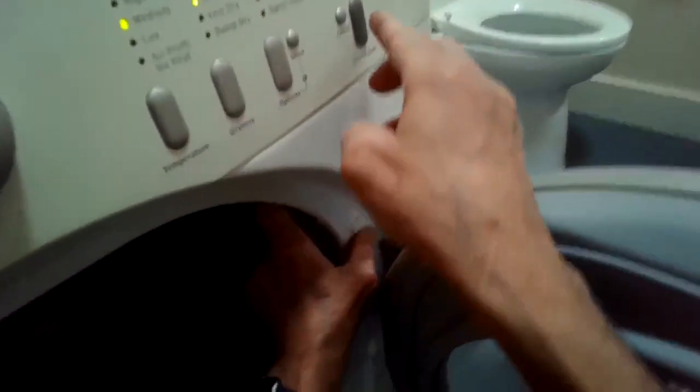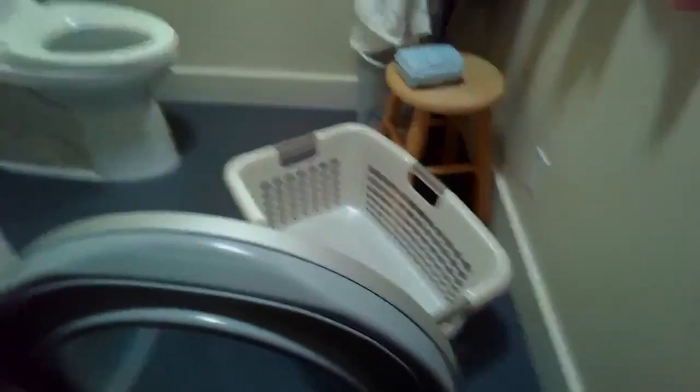And if we look in here during the drying period, we see a weird bright light up in the upper corner. You can even see it when the door is open. And that is due to a broken element. The spring broke and it's touching the metal, so it's a short circuit, and it'll just stay on full blast all the time, and then the dryer will cut out from its thermal protector,